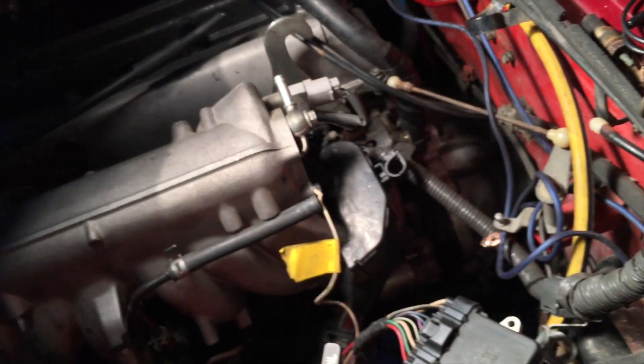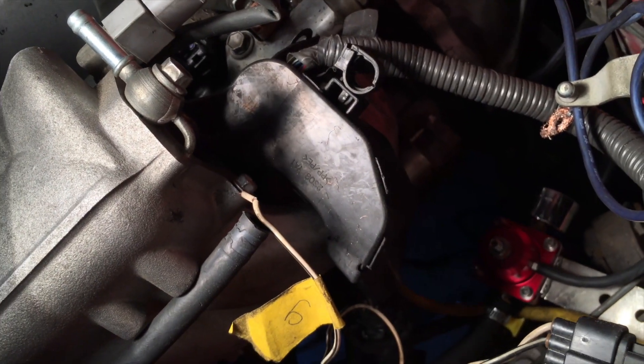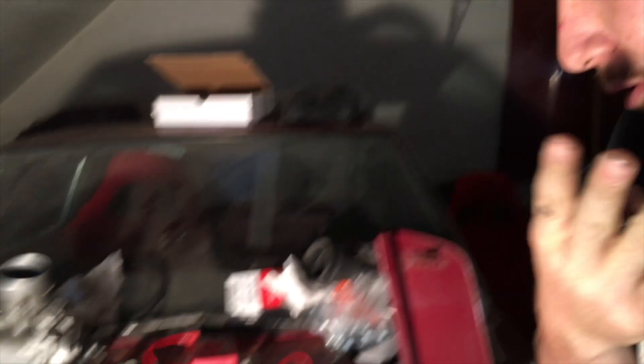So what you need is: power to the coils, power to the injectors, ground the igniter, hook up your starter with one big gauge wire straight to the battery, and one small wire to the solenoid. When you push the start button it'll engage the solenoid. You also need to hook up your fuel pump.